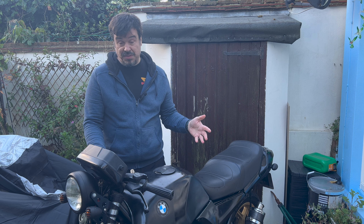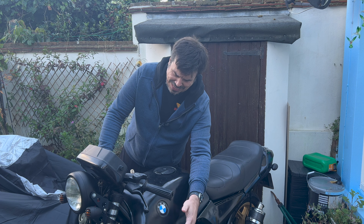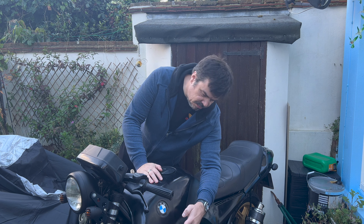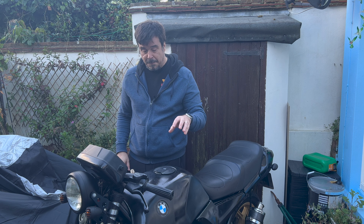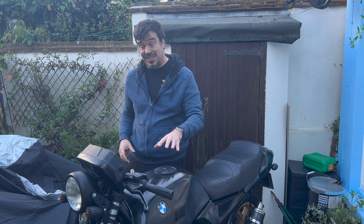I've also been shopping for a few things. I've got a fuel injection pressure test gauge — it's 25 quid off eBay. I don't know how great it's going to be but it should let me see how much pressure is going into my fuel lines. It connects in-line before the fuel rail so I should be able to see what the pressure is like. I've also got a compression tester coming so I can check compression on all the cylinders — that could be where I'm getting only one or two cylinders firing but not all of them. Once those parts turn up I need a few hours of dry time to test that out.